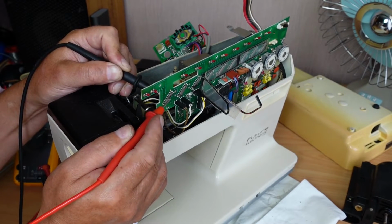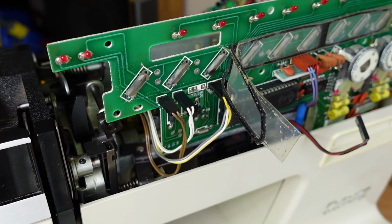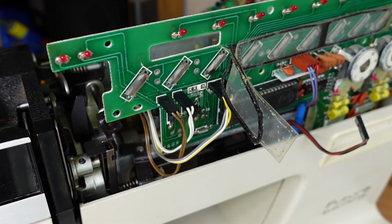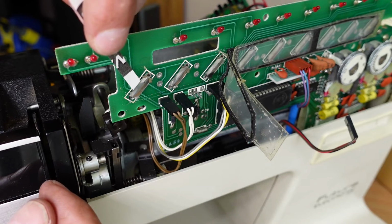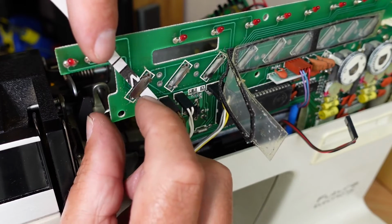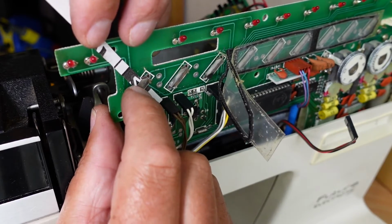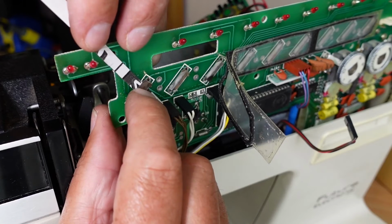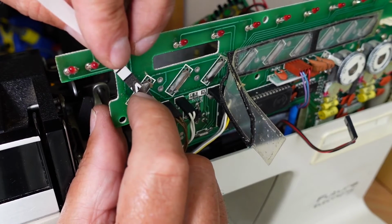Oh, did a little bit there. I've got this 280 grit sandpaper. It's pretty fine. I don't think it'll do any damage, and you don't want to be sanding for too long here. You just want to slip the sandpaper in between the contacts here. So I've got the gritty end facing the rear part of the switch, and I'm just going to push and hold the switch gently and drag the sandpaper through backwards, and then release and just drag it through a few times,